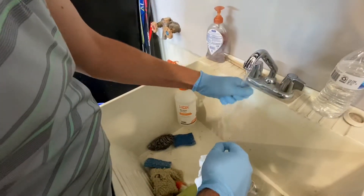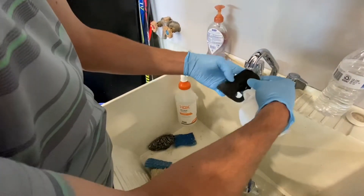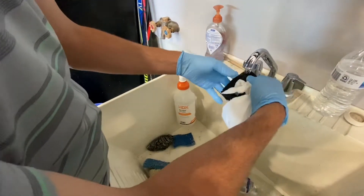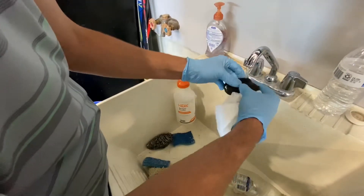I'm adding a little dish soap and water for a final rinse to make sure it's really clean — it was pretty dirty. You want to make sure it's completely dry before adding the filter oil, so we'll rinse it out, squeeze it out, and then set it in the sun to dry for a few hours before coming back.